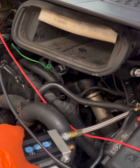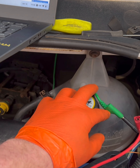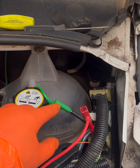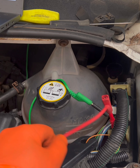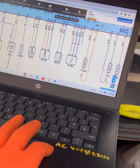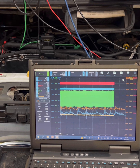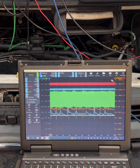Set up here, I'll quickly walk you through what we've done. WPS clear pipe coming from the fuel filter through to the fuel pump. This is the green wire going straight to earth - that's to where we've grounded the pin to the engine control relay, just so we can continue running the tests. Duty cycle for the suction control valve current, the orange wire. And here's our rail pressure - the green channel is rail pressure.